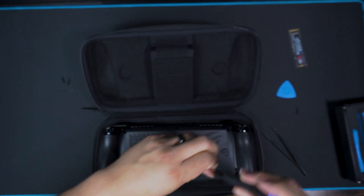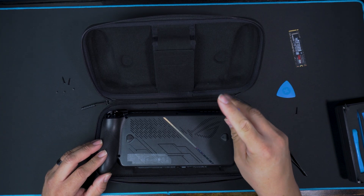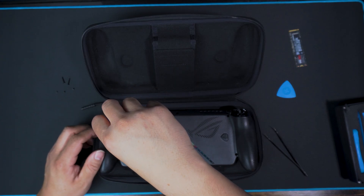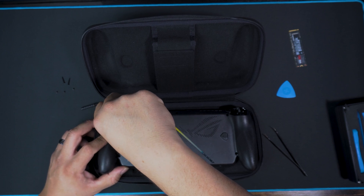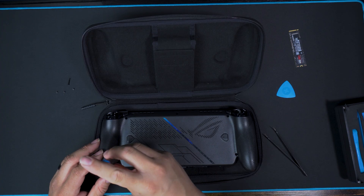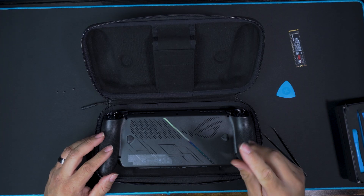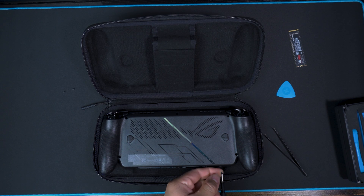Get it good and tight — you don't have to get it crazy tight. These are my two top screws — throw those in first, one here, one there. Get this screw in — you can hear the thumb stick pushing down a little bit. Make sure it fits in there flawlessly and screw it back in. Once they're tight, not even a quarter turn more — just an eighth of a turn. You don't want to strip the screws, or you'll be stuck if an eight terabyte ever comes out or if you ever want to change the joysticks to hall effect or swap any buttons.